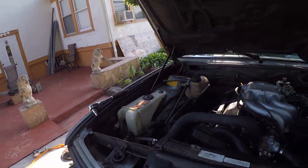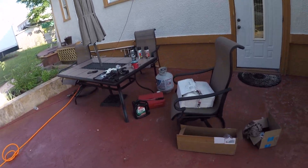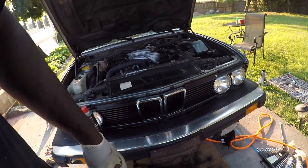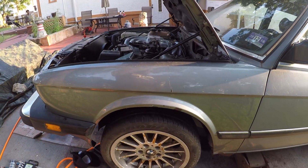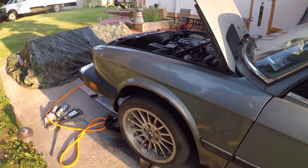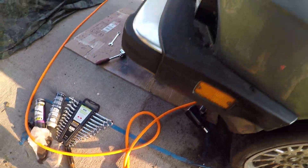I'm taking a quick break to hydrate - it's hot out here. Then I'm gonna go finish this side. Both sides are on, my brother is taping that up for me so I can do a test spray. I got the rotors here - I showed you guys that earlier. I'm just gonna hit these with some brake cleaner, put them on, put the wheels back on, and tighten up the suspension. So the wheels are on temporarily. I was able to tighten up everything on the suspension - all the suspension components are tightened. I think I tightened the driver's side a little too much the last time I was here. I noticed that when the car was jacked up the passenger side seemed to droop down a little lower than the driver's side. Worst case scenario I just have to loosen it up again, put it back on its load, and redo that.